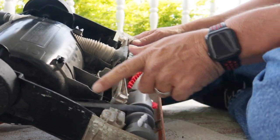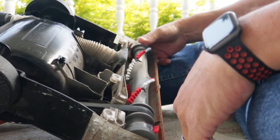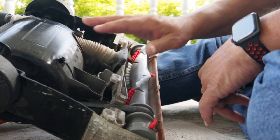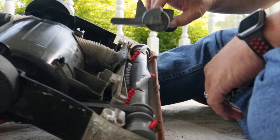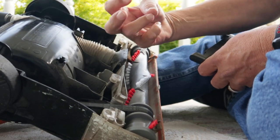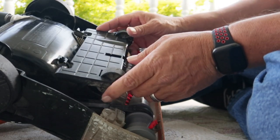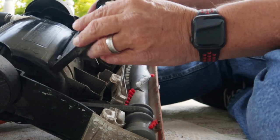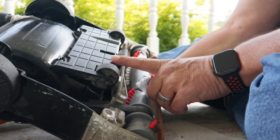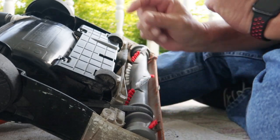You can turn it a couple times just to line up your belt with the motor shaft so that everything, when you go to turn it on, is in its proper place. And all we've got left now to do is put on the leveler — and that's this piece here. It's got an adjustment inside for thick carpet, low carpet, things like that. This is the plate that moves up and down; that allows you to ride higher on lower carpets. It just slips into place just like that. Now when you turn this little knob on the front, it jacks that up high for a high pile carpet. Turn it the other way for low, thin carpets.